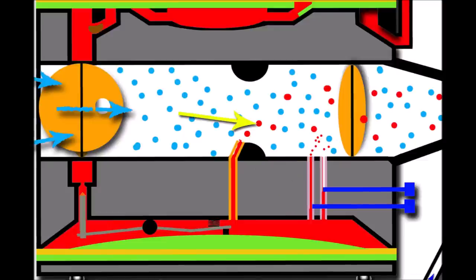The fuel in the metering area can travel through these little fuel veins — like pipes — to get to the inlet area. Although the main jet is responsible for the main source of fuel, these little fuel veins are designed to contribute to the total amount of fuel going into the inlet. The engine is designed to run effectively by receiving fuel from both points. The fuel from the main jet is the main source for general engine running, and the amount from the fuel holes is much smaller — designed for fine engine tuning to achieve a precise air-to-fuel ratio.